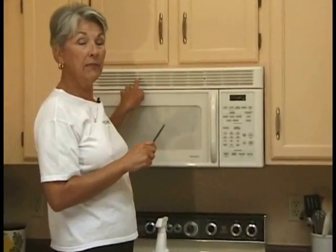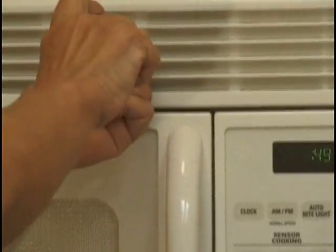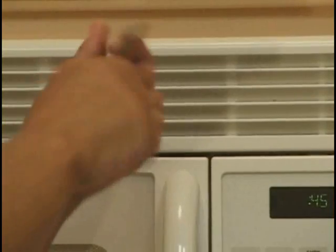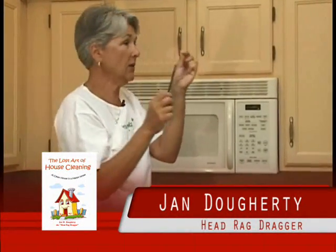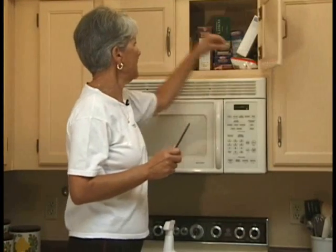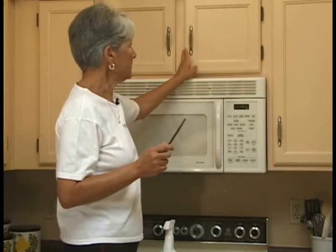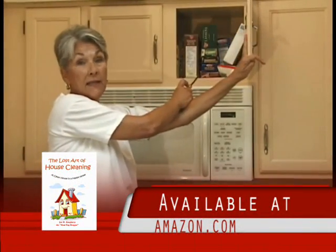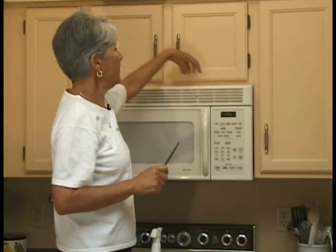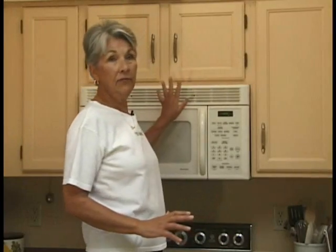This unit has two screws in the front. When you're removing these screws you have to push very hard while you're turning the screw in order to get it out. If you just roll your screwdriver across the front of it you're going to strip the slot and you'll never get the screw out. I teach my girls that when they remove the screws from the microwave, they put them in the top cabinet right here, so that when you finish the job a couple of hours later you know exactly where the screws are. Put them in there because when we clean — like I said in the book — we don't go into any cabinets, closets, doors, or drawers. So we will not be cleaning the inside of this cabinet, just the doors and the hardware.